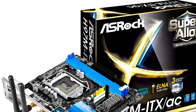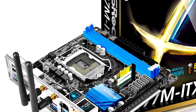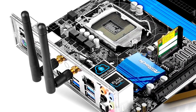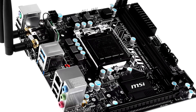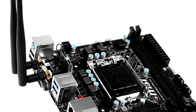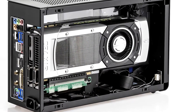Some higher-end motherboards have onboard Wi-Fi built into the rear I/O panel. Most motherboards don't include it — you usually pay a premium for it. If your motherboard has onboard Wi-Fi, set up the antennas before installing it in the case because it becomes very difficult afterward. This is especially relevant for mini-ITX builds, which often won't have room for a PCIe Wi-Fi adapter. So if you want a mini-ITX build with Wi-Fi, you'll likely need to pay extra for a board with onboard Wi-Fi — yet another reason I recommend the largest form factor that fits your case.